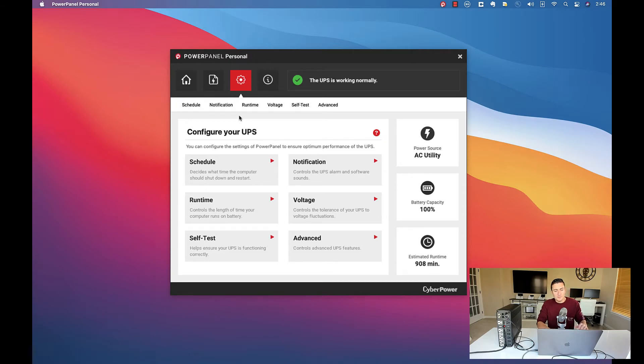If you go over to the settings tab, another interesting thing you can do: if this thing is constantly plugged into a desktop or server via USB, you can actually have it shut down that server or desktop after a certain number of minutes. The reason you'd want that is because without a UPS it's a hard shutdown — but even with a UPS, once the batteries die it's another hard shutdown. So this lets you stay up for, say, five minutes hoping it's a quick brownout, and then gracefully shuts down the computer before the batteries run out. That's all configurable in here.